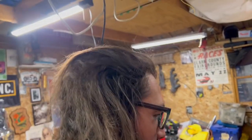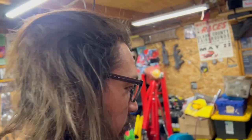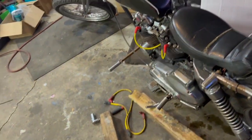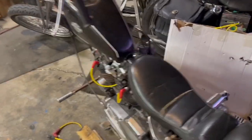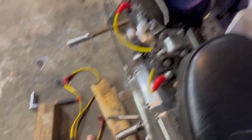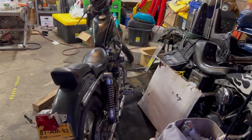Now we're out of gas — perfect, that's what I wanted. Been having a hard time starting this with it on the kickstand, but it works perfect on the boards. I don't want to adjust the timing because I have been consistently getting it started. I took a two by four and a piece of fence material — that height is where I want it. I definitely overbent the kickstand with the Mikuni on there; I think it's leaning over too far. I was kicking this for 10 minutes and could see a little bit of fuel shooting out the overflow. Got the bike a little more vertical and still have plenty of leverage.